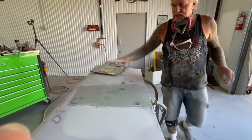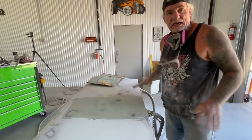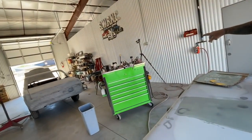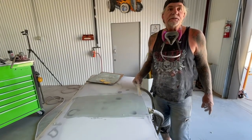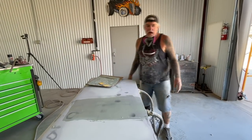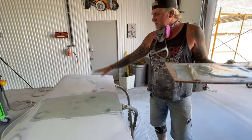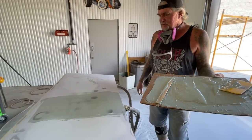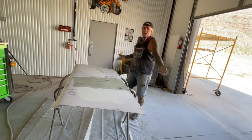So what we did is we added our Bondo mix. Normally we would add it, leave it, and come back with our sanders and sand it out. But what I did is I eliminated about 20 or 30 minutes of work and $10 worth of sandpaper, and we got it more accurate — because by the time you sand all that Bondo down, it's going to look like that anyway. So we'll let that dry, come back with our sanders and sand it, and it'll be done. That's how you self-level your Bondo on your final destination of doing bodywork on something major like this. That should be the last skim coat I need — you can see that's a skim coat, not super thick. That's how you do it.